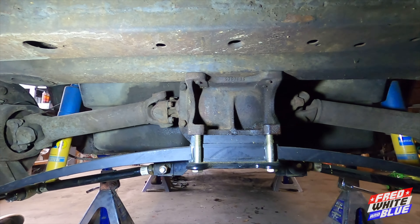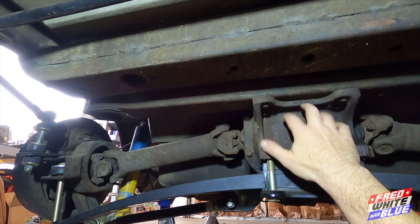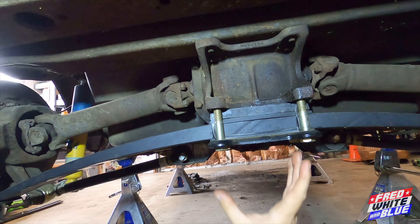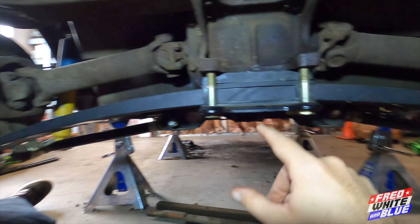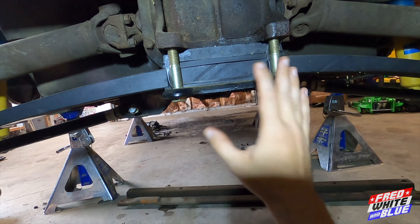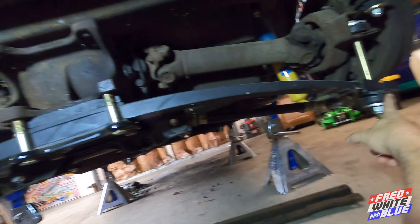Here's what we're looking at. Pretty simple, pretty straightforward. We have this cross member right here with two bolts. The rear cover of the rear differential is pretty heavy duty and that's how the differential is mounted — four bolts go up into this cross member, so it kind of hangs there. The suspension is bolted to the bottom of that. Right here we would normally have like an 80-pound nine-leaf leaf spring that goes side to side, but years ago I replaced it with this carbon composite one. It's a lot lighter and does the same job. So I've got to detach the spring on each side and then undo the four bolts to lower it down.